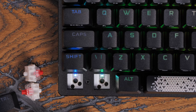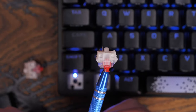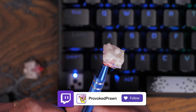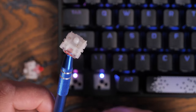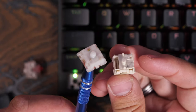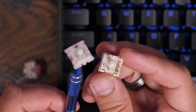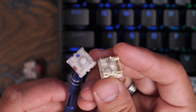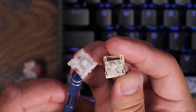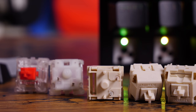They're relatively easy to remove — no soldering required — giving you an upgrade option. One downside I found almost immediately is that this is only a three-pin setup. Cherry MX style switches come in three-pin or five-pin configurations. Here's a close look at the Cherry MX RGB Reds — a large stem in the middle with two metal prongs for the connection. Novel Keys Creams, for example, are five-pin so they wouldn't fit here. If you're thinking about upgrading switches, make sure they're three-pin, not five.